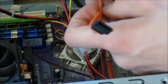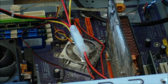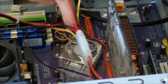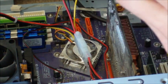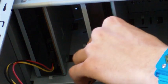We're going to start with the newer devices that use the SATA cables before we crowd up the machine with the big fat ribbon cables for the older stuff. These orange plug-ins right here are all the plug-ins for SATA devices. It's an L-shaped bracket, so very hard to mess up. Just take the cable and plug it in, then take the other end and plug it into the device. Repeat again for the next cable. With the two SATA cables plugged in, we now have data going from the motherboard to our disk drives.